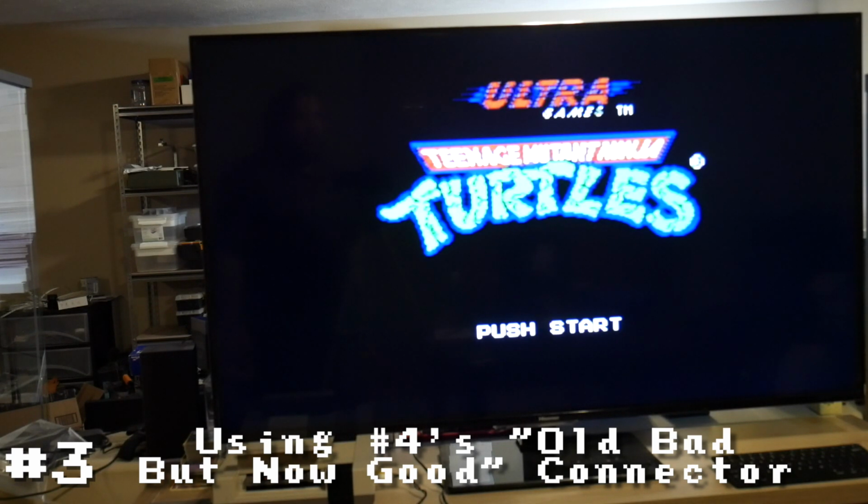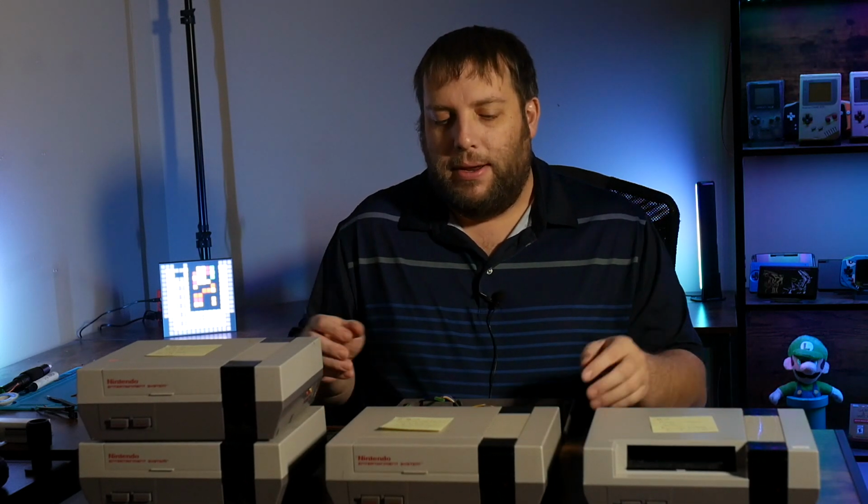So now it's time to wrap up the video. Well, I think that about wraps it up for this video. Out of the 4 systems that we worked on today, all 4 had issues with that connector, and we managed to get 3 out of the 4 working when it was all said and done. The only one we didn't get working is this one here, which I'm pretty sure is due to one of the SRAM chips on the board. Looking online and seeing some of the symptoms that other people have had, it appears that it's probably the VRAM chip on this board, and I don't have any spares of that, so for now this system's going to have to sit partially working.